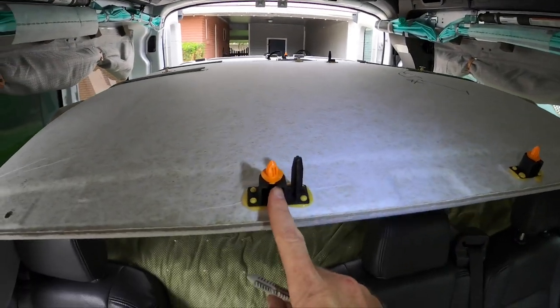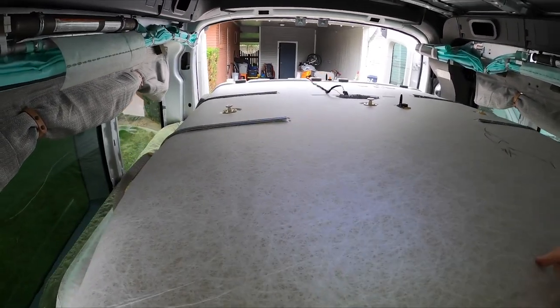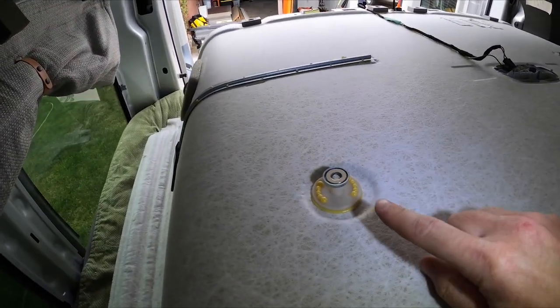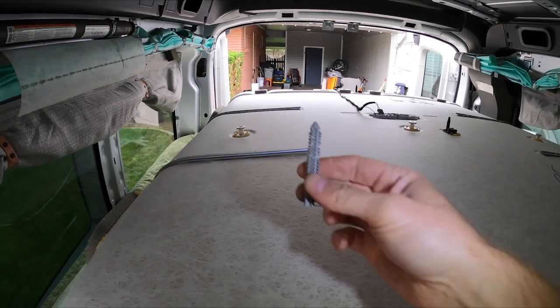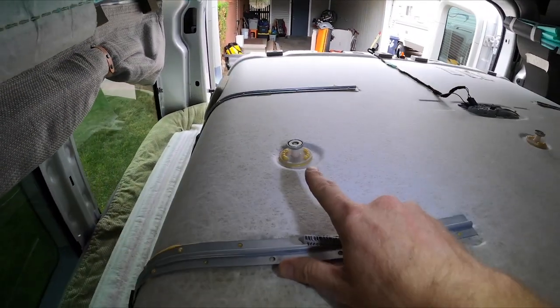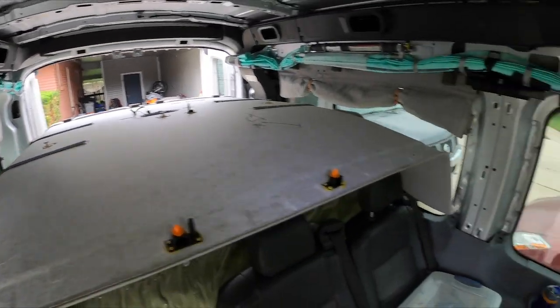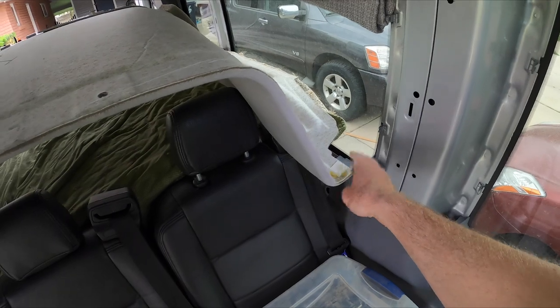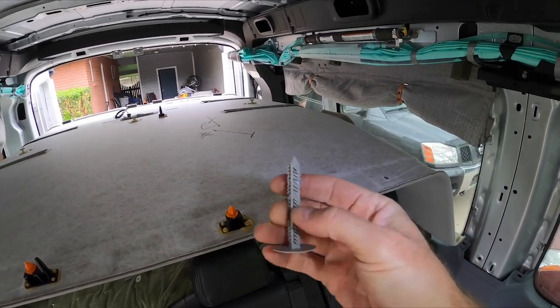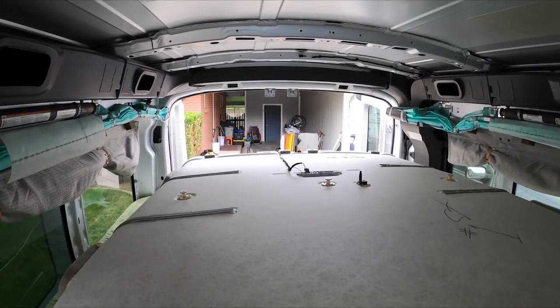They also have these little compression pins that you have to pop out. But on this particular one, because it's so big, they have these intermittent supports which are just magnets — the magnets just magnetize onto the steel rim right here. So a few different ways: push pins, compression pins, and some magnetic things. They're really not that hard to take off. You do need to take off the column covers because the edges tuck into them — just pop off the column covers, pull these out very gently, and it really comes down. Just be mindful of the light cables.